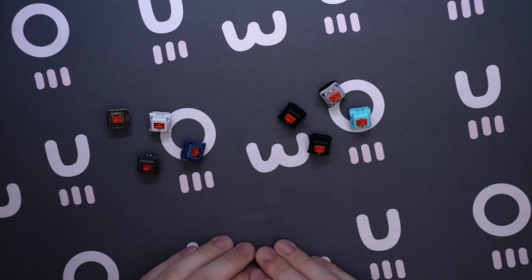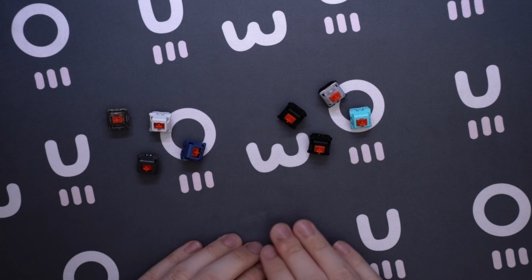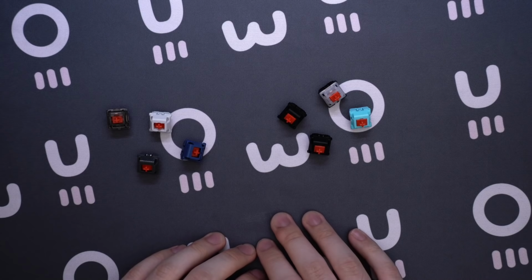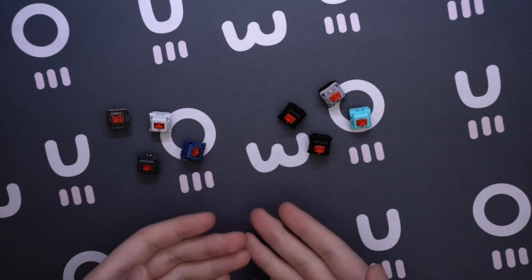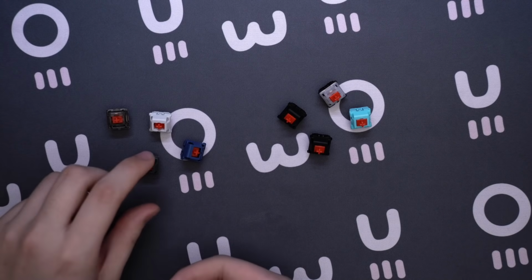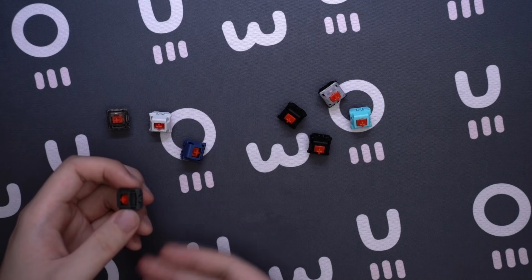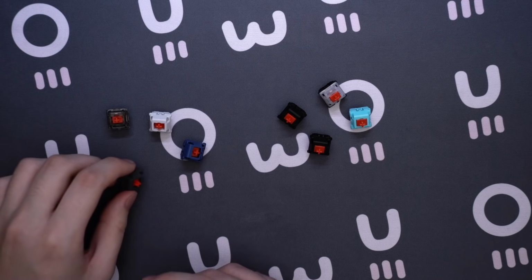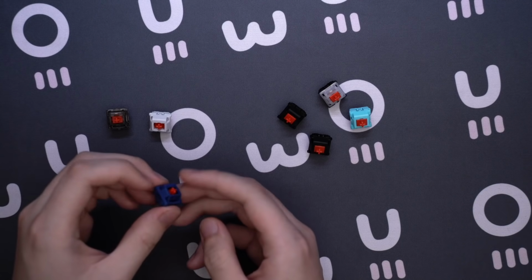As for the usability of these stems in other switches, this information should be taken lightly since the production unit might differ and there is also the problem of switch variants, but from a quick test I did, it seems that the stems do not work with JWK/D-Rock housings. I tested Alpacas, Marshmallows, Tangies, and all seem to get stuck. This also occurs on SP-Star housings.